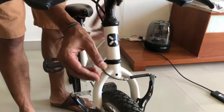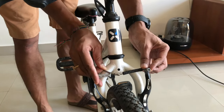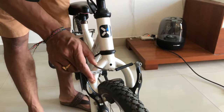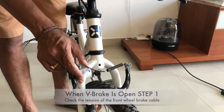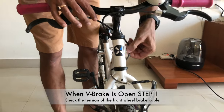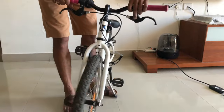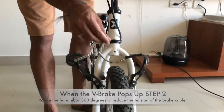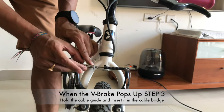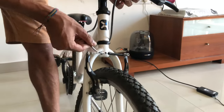The second problem is very common: the brake cable guide and cable bridge have popped open. This can happen with any bike — kids or adult — and only happens on the front wheel because the handlebar can rotate up to 360 degrees. First, analyze the tension on the wire; you can see it is too high. To fix it, rotate the handle 360 degrees so the tension is gone. Then hold the cable guide and the cable bridge and simply insert the guide back into the bridge — it is fixed.